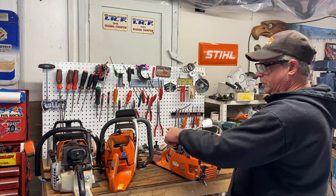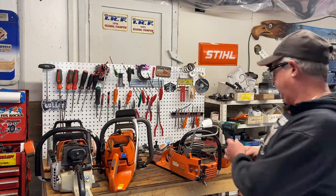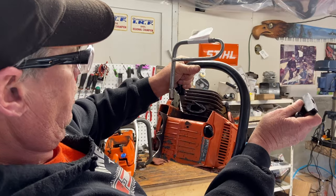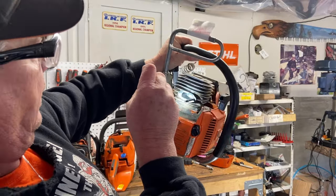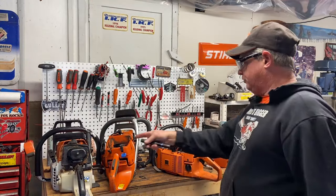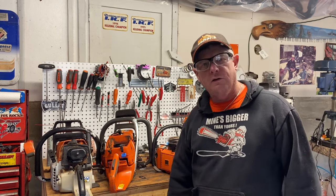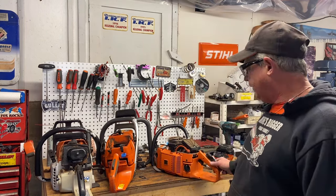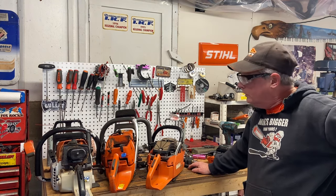It's got more compression than the other two — and those two are not scored, I've had the mufflers off. But look at this: scored piston — hopefully you guys can see that. The rings are still moving, but this one has more compression than those two newer saws. It's a one-ring piston; those are two-ring pistons, and they've got less compression than this old 61. So don't rely solely on a compression tester for two-stroke stuff. Pull your muffler off and have a look. This engine will probably run but it'll die out, have no power, and start taking the chrome off the cylinder producing aluminum shavings.